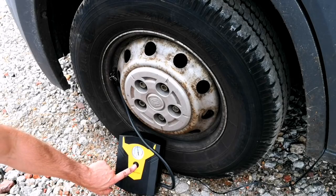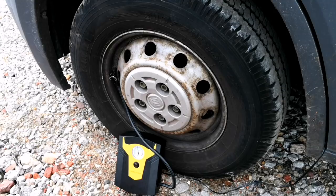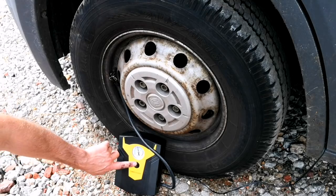I've just quickly pumped up the tyres — they were just down by a few psi, but it's safe stopping at a petrol station. That's why I bought that little pump — it's suitable for these great big tyres, unlike the inflators at petrol stations which are good enough for a normal small van or car doing 30–40 psi, but they really struggle when you start getting up to 65–70 psi. I run 65 at the front and 72 at the back, and that takes forever.